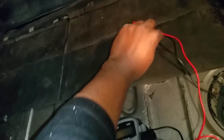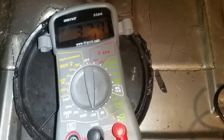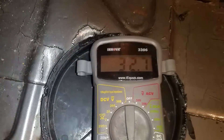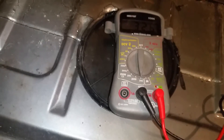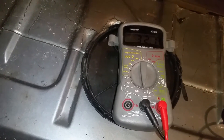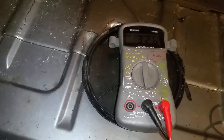I'm going to take the two leads and put them up against the two terminals here. I'm running 33 ohms with these two connected. That indicates just about what we should have — I think it's around 41 ohms for half a tank, and resistance goes up with less gas. So the reading the sending unit is sending to the gauge is dead-on accurate. There's nothing to troubleshoot with my gauge or cluster.